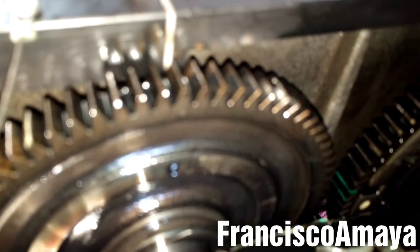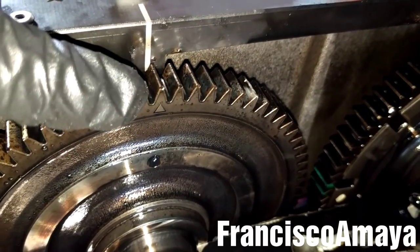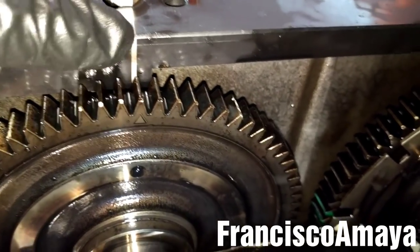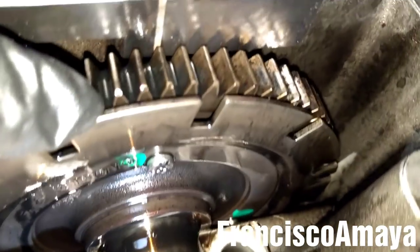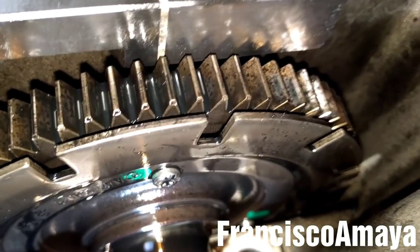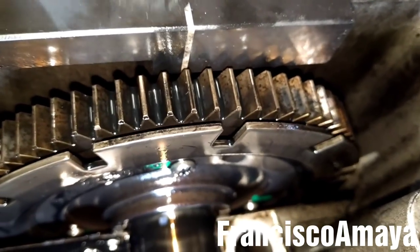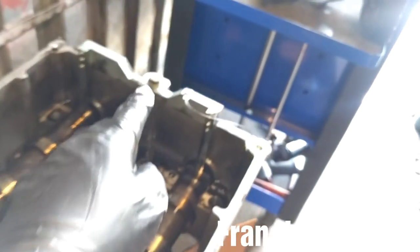So to put it back together, all you have to do is to set this mark. You have to align that mark with this line over here on the back. The other one is right here, it's behind this plate — it's hard to see it behind the plate. You can barely see it over there. Put it like that, and then set the timing on the back.